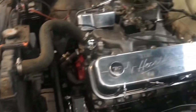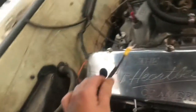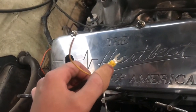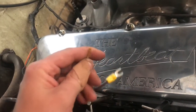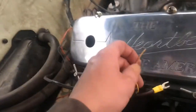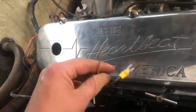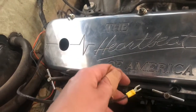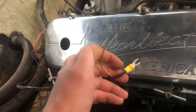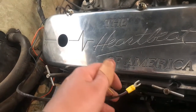I've got the headers painted and installed, all the front end together, everything hooked up. Just doing some wiring and getting it ready to fire up. This wiring is a bit of a mess — this one goes to my starter solenoid, and this one goes to where the positive on the battery connects to the starter. Some guy said the purple goes to the big prong and the yellow goes to the start solenoid, but I did a test light and when the key is in the start position, this is the one that has power.